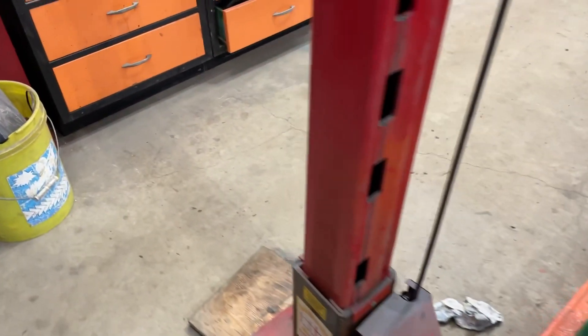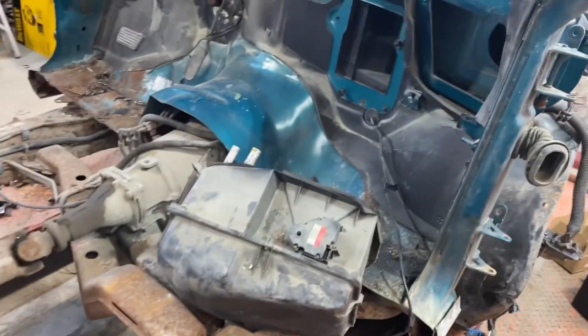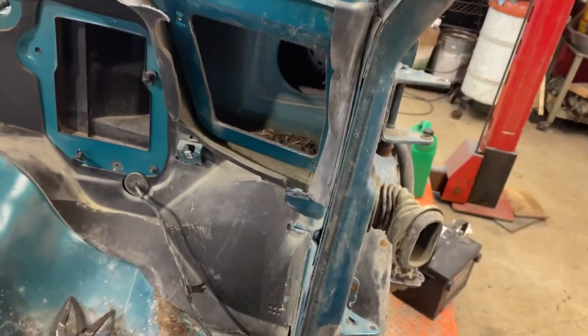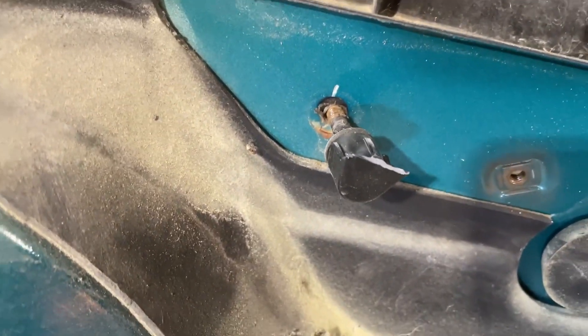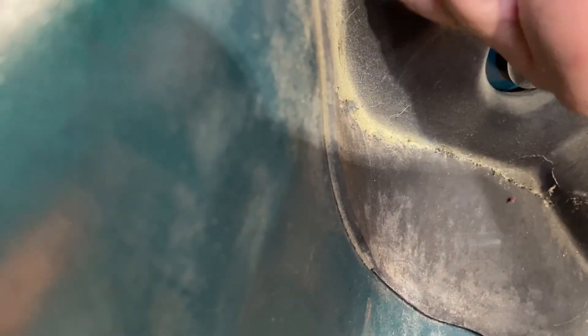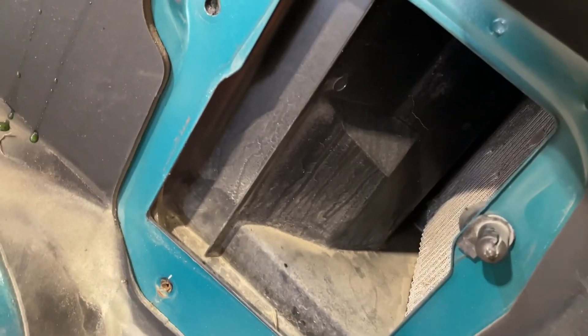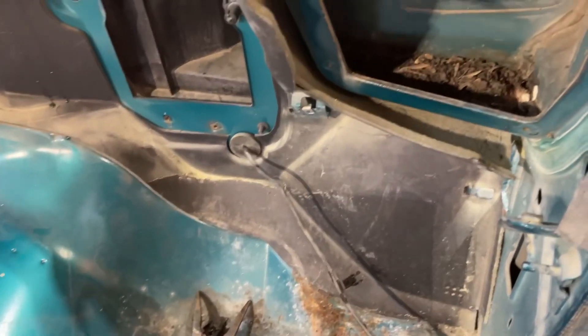It's been a few minutes. I went ahead and did this without you guys, and for that I sincerely apologize. So, this S10 inside heater box — stupid design. This bottom one wouldn't come off from the outside, which I thought I had totally threaded out. That one spun off, but there's a bolt right in the middle that holds it. The bolt is inside the air conditioning box, which explains why that nut won't come off. I'll clamp a vice grip on that and at least take that piece off gently.